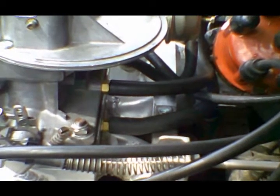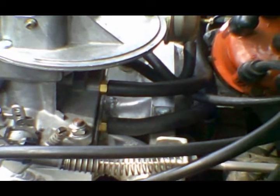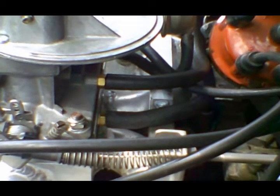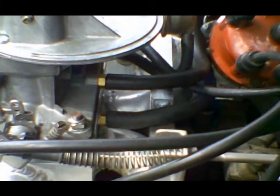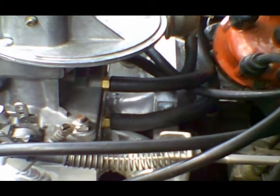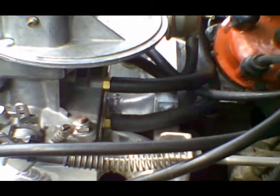Now it's time to connect the hoses. This is a straight drive, so it has two hoses at the back — if it were an automatic it would have three. The 5/16" hose is PCV, going to the PCV passages in the carb base. The 3/8" hose is full manifold vacuum going to the HVAC and brake booster. An automatic conversion would add a 3/16" hose going to the modulator valve in the front of the automatic transmission.